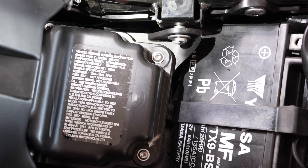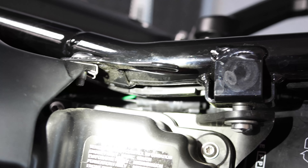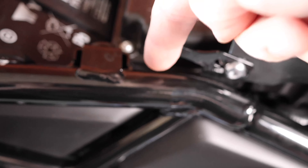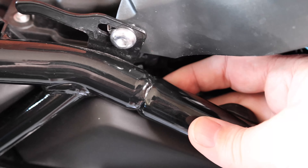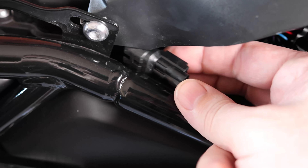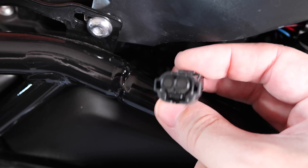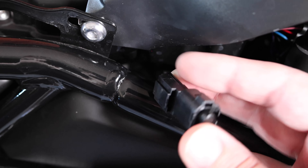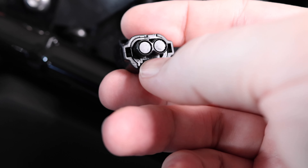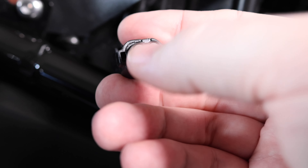Right in front of the battery is the airbox, and just to the right of there I do see a little wiring harness down there, so I'm going to try to fish that out. I was able to stick a blade down there and kind of split the electrical tape to get to this harness right here. I'm hoping this is the right one. There's a little blank on the end that needs to be removed — to remove it, you're going to need to push down this little lock connector in the middle and then pop this part out.